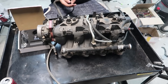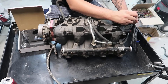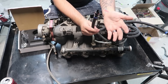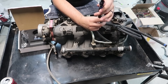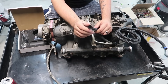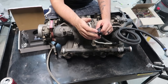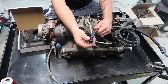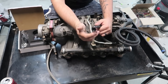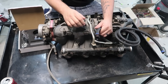Now that we've talked about hose and the pipe fitting on the intake, basically what we do is go ahead and make our AN line. I have a video showing you guys how to make these AN lines — really easy, not complicated, you don't need any tools. However if you are going to make a bunch of them I would recommend getting a cheap AN aluminum wrench because 90% of the time you end up marring the surfaces. If you're particular about that you'll want an aluminum wrench to tighten these down.